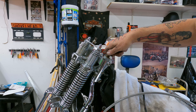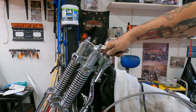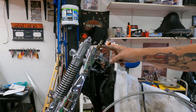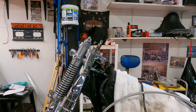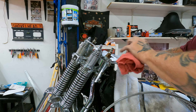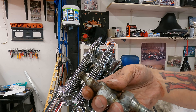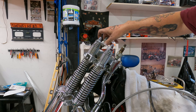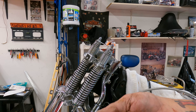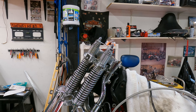Since I'm not going to be disconnecting the rockers, I don't need to tie them up. I just want to get the front end off of here, so we got to take these out and then we can take the triple tree out. We got these out — those are the rigid fork studs. I'm going to replace these anyway since they're kind of rusty. It was a good call to do the stem bearings on here, because if the rest of this stuff is any indication of the condition...